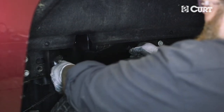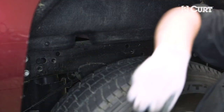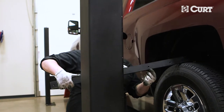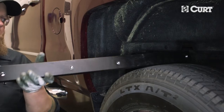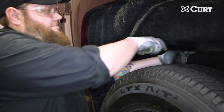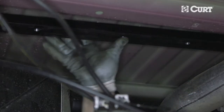Remove the side plate. Next, prepare to insert the rear cross arm. Notice that the holes are closer to one edge — this edge should be facing the back of the truck when inserted, so after the cross arm is rotated into position, this edge will be facing downwards. Slide the rear cross arm between the frame and the bottom of the truck roughly above the rear tire.